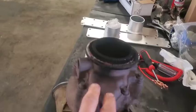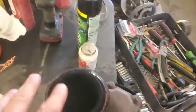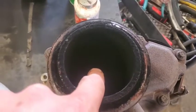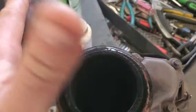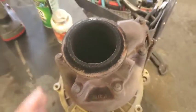So I'm going to get this top cover off here, which is also going to aid in getting the new wheel put on, not on this side, the other side. This is the exhaust port here. The wicked wheel goes on the intake here. Some of the things you're going to notice differently is I've deleted the exhaust back pressure little butterfly valve here. I just put a 3/4 inch freeze plug there. I've got another video where we did that.